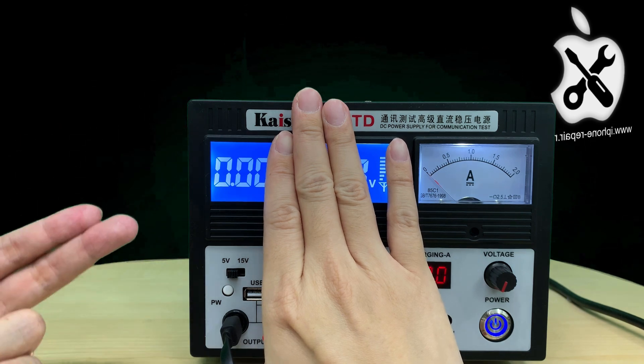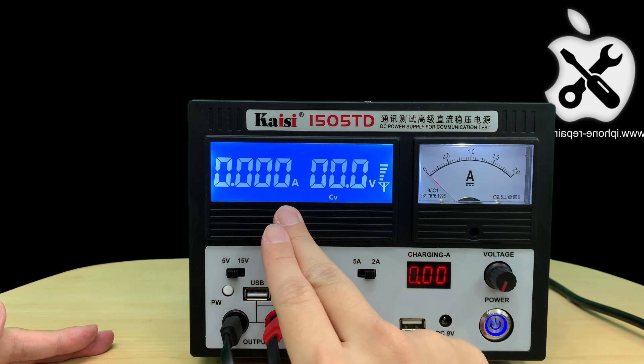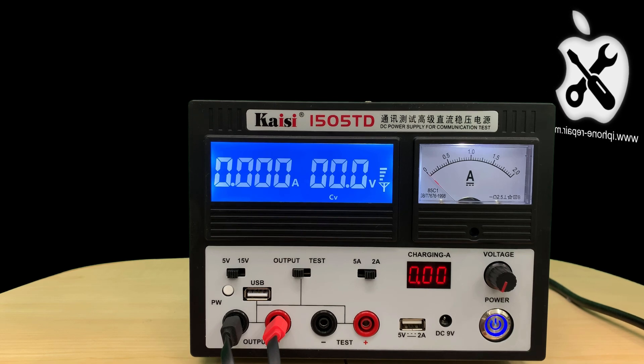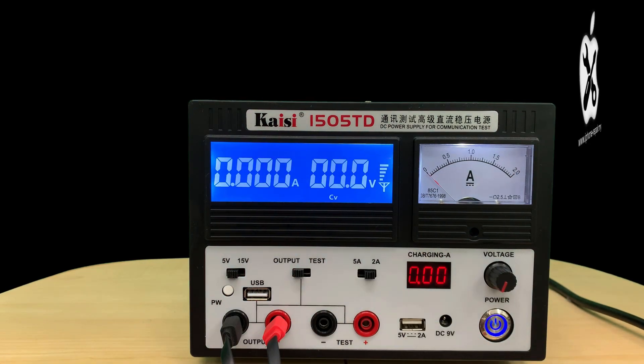You can only know it's 20mA. But there's a big difference between 28mA and 20mA. By that I can already guess whether the CPU is not working, or some of the CPU coils are not giving enough power to the CPU. The minor difference matters.